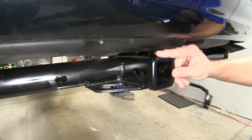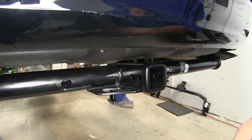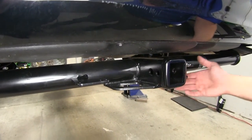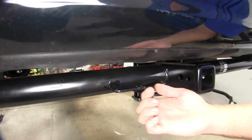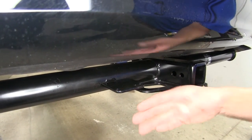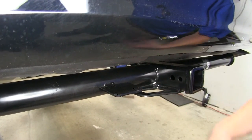You can see the reinforcement collar — it's got a rounded look and will sit slightly inside the bumper, so we won't have to worry about bumping into it. There's a nice plate-style safety chain connection point with a large, open connection area. They've also welded a tab with three pre-drilled holes, so if you're doing any wiring on the exterior of the vehicle, you can get brackets that attach there to help secure it.